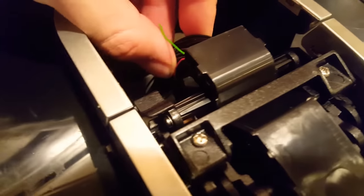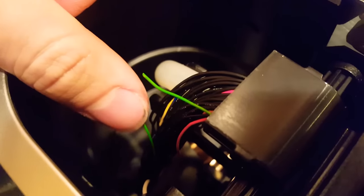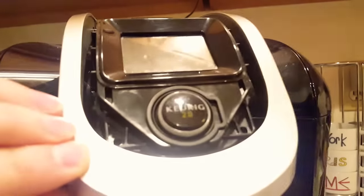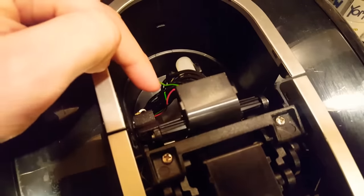So the next thing you're going to do is go back here where the wiring is and you're going to look for the only green wire. It's a green wire that leads down to the bottom, as you can see right here. You're just going to go ahead and cut that green wire, and what this is going to do is bypass the optical sensor. The optical sensor in these Keurig 2.0s is located right here in the square part. It is just tucked back away in here so that when this comes down on top of the K-cup, it sees through this little hole which kind of K-cup you have in the dispenser. So when you close it, if it's not the correct type of Keurig cup it'll say error — this K-cup is not compatible with your Keurig machine. By bypassing that, you can use any K-cup you'd like.